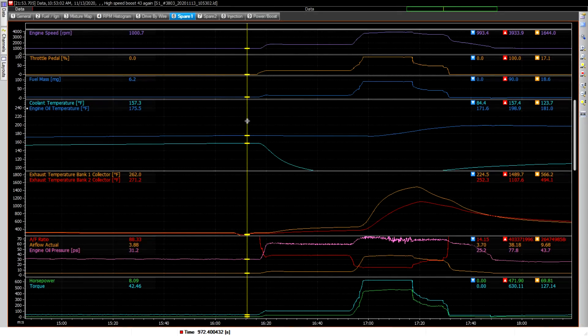Let's take a look at the engine log for that run. When I started out, just before I pulled onto the runway, I turned the heater on, so coolant temperature was up to 155 and oil was 175 - and obviously when I turn it on it plummets, which is what you see there with the teal line. Then I got up to full power: RPM initially 3,689, and the maximum RPM reached was in the high 3,800s - I think it may have hit 3,900 somewhere.